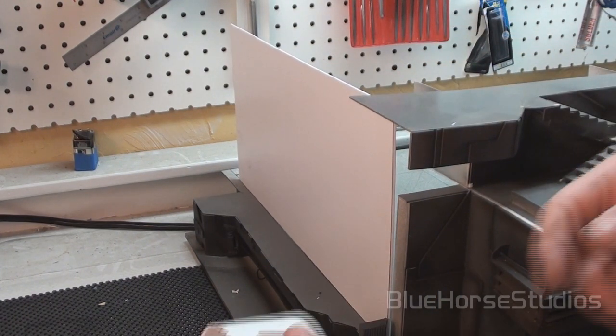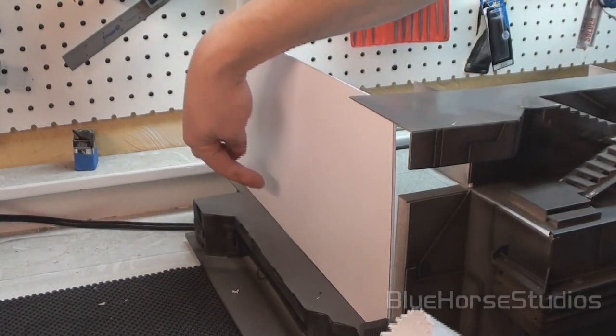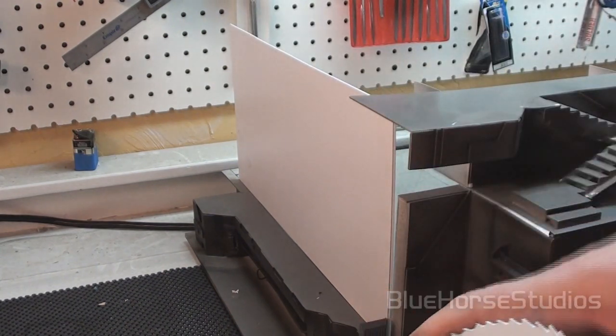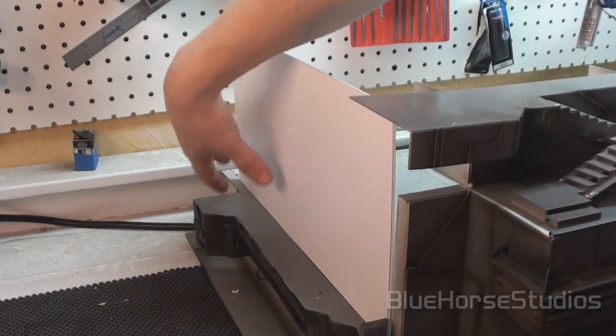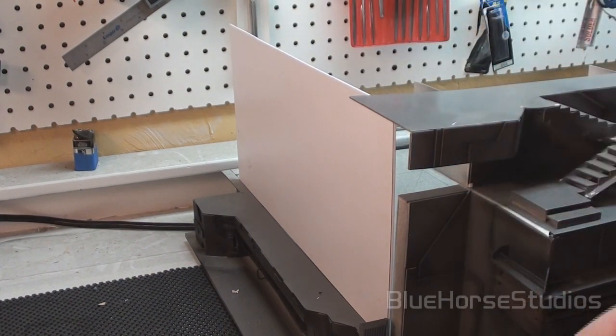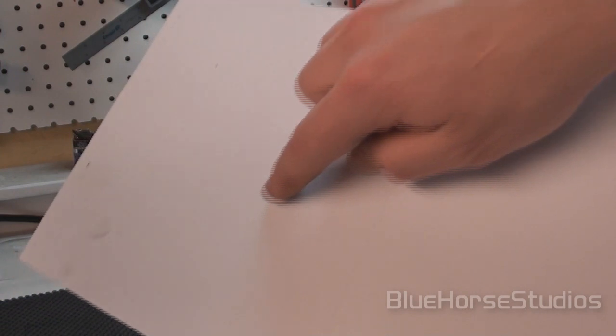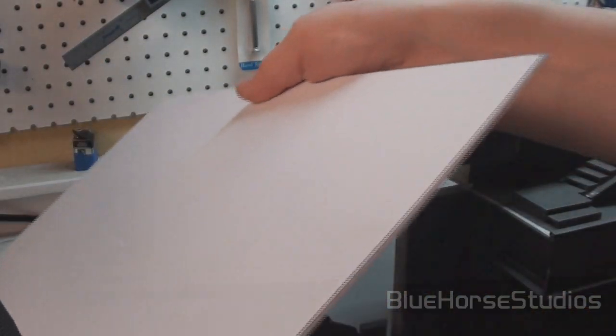And then what I need to do is take my 3-inch hole saw attachment and drill out 2 80mm fan holes here. I'm not sure exactly where I want to put the holes, but I'm thinking right here on this area because the motherboard tray is going to be right behind this panel. So what I need to do right now is take this piece of stock styrene, start measuring out the areas where I want to drill those holes, and then get this part attached and start building up the structural supports in between the panels.